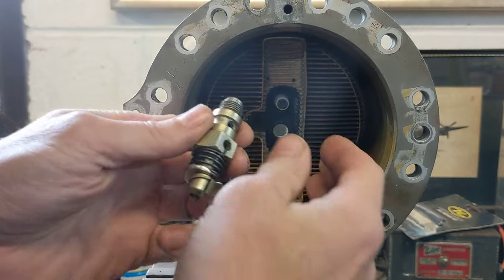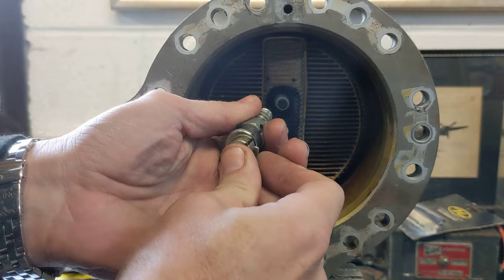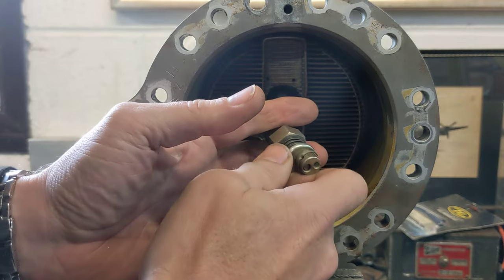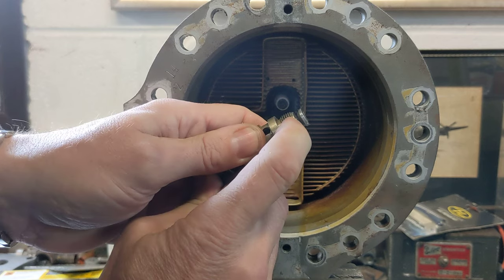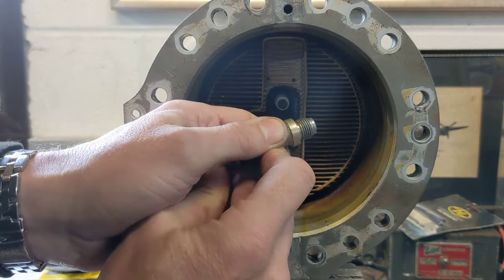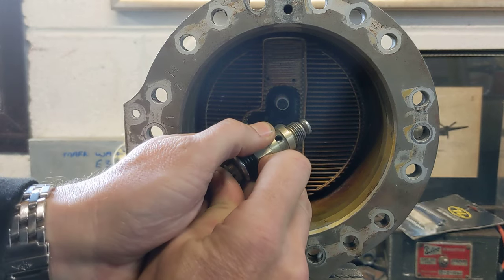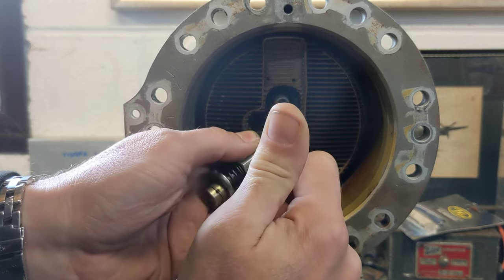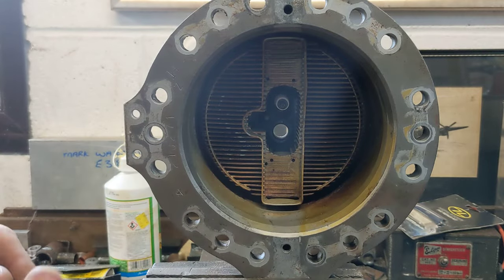Taking the head off the engine that's in the bike is a bit of a pain because you'd need to take the engine out. It used to come out, but we've since put the gusset plate in the top to hold the coils and now it won't come out without removing the engine. I know the engine's coming out anyway, but if I don't need to take it out before I try and start it, that will be so much better. There's also the question of whether that small hole will let enough pressure out to turn over the engine at the right speed. What we'll probably do is activate the decompressor, let the Dynastart take the engine up to the right speed, then at exactly the right moment — just at the top of compression — snap it shut and let the momentum of the 50kg flywheels take it over top dead centre, with the Dynastart still engaged, hopefully at 80 RPM to energise the ignition.